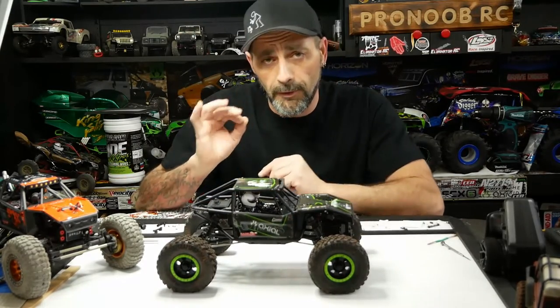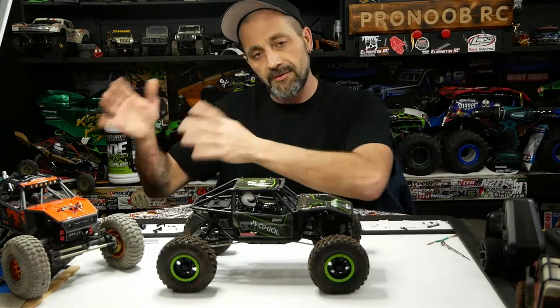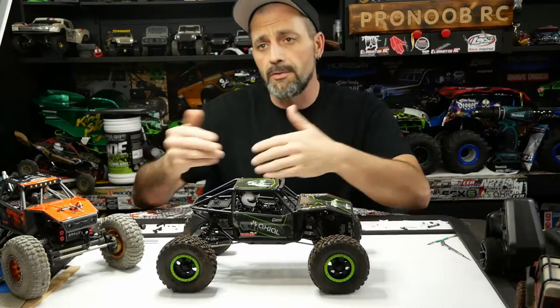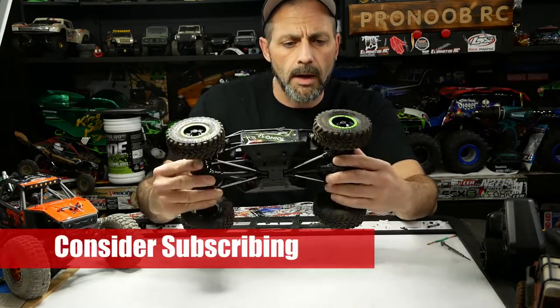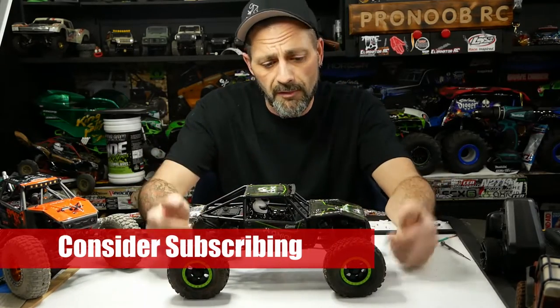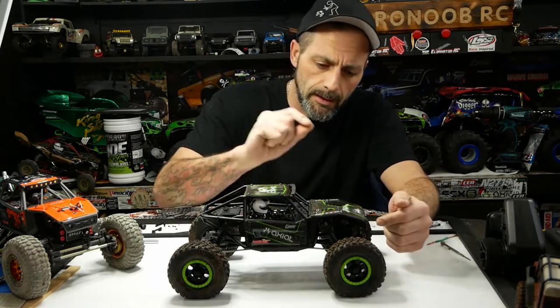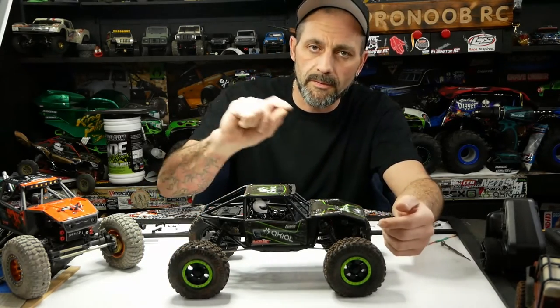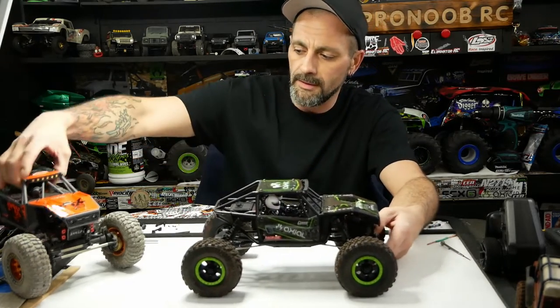We did not film the entirety of that build. We kind of wanted to go through it as we do. That's why we kind of have two of everything. We do one first, then we do the build on film for you guys. So first modification, we want to lower it down, so we're going to pull the shocks off and lower those, and then we're going to internally limit them. We're going to put a little bit of fuel tubing on the inside so they can't come up as high, keep that center of gravity low like this guy's got done.